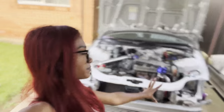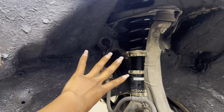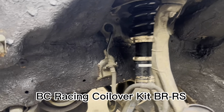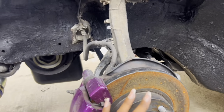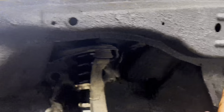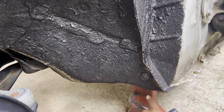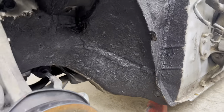Now for the suspension and wheels. On the car I've got BC Racing coilovers — I'll put the exact name in the description. I've got slotted dimple rotors, which are a bit rusty because the car's been sitting on jack stands for a while. I also did undercoating under the wheel arches because there was a lot of surface rust — the factory coating was peeling off and starting to rust, so I redid the whole thing.